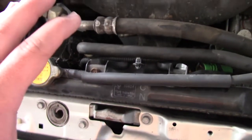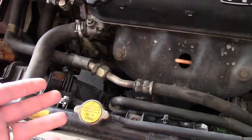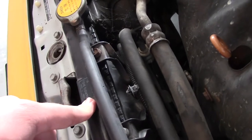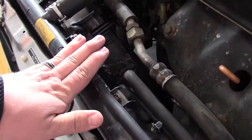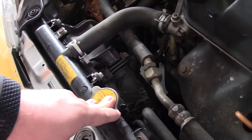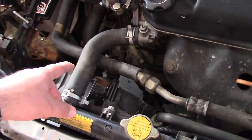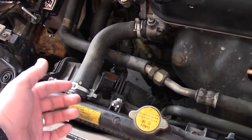The issue is the CRX has been overheating. What happens is when you take these 30-year-old cars and run them hard, this plastic piece will separate from the radiator below and that usually causes a leak along here. We need to replace this radiator. In addition to replacing the radiator, it's a good idea to change the hoses as well.